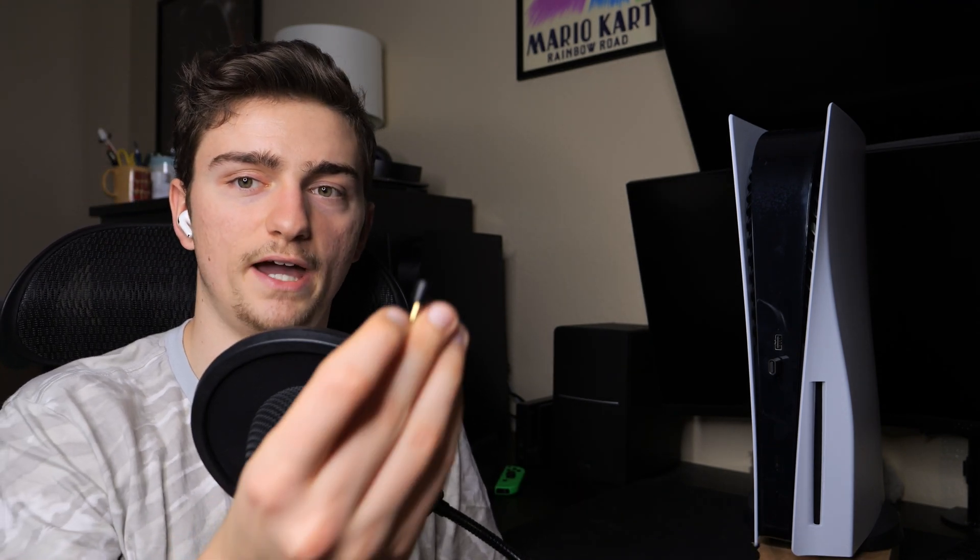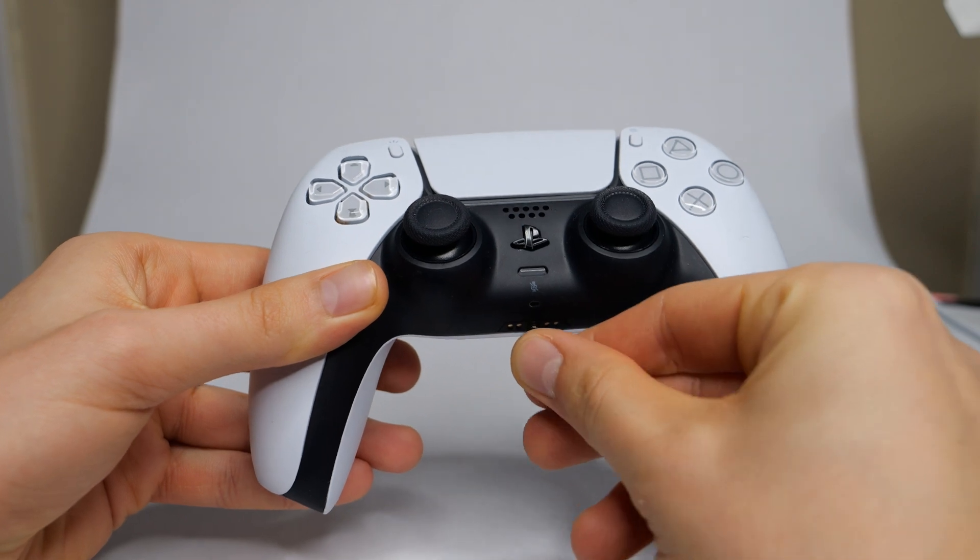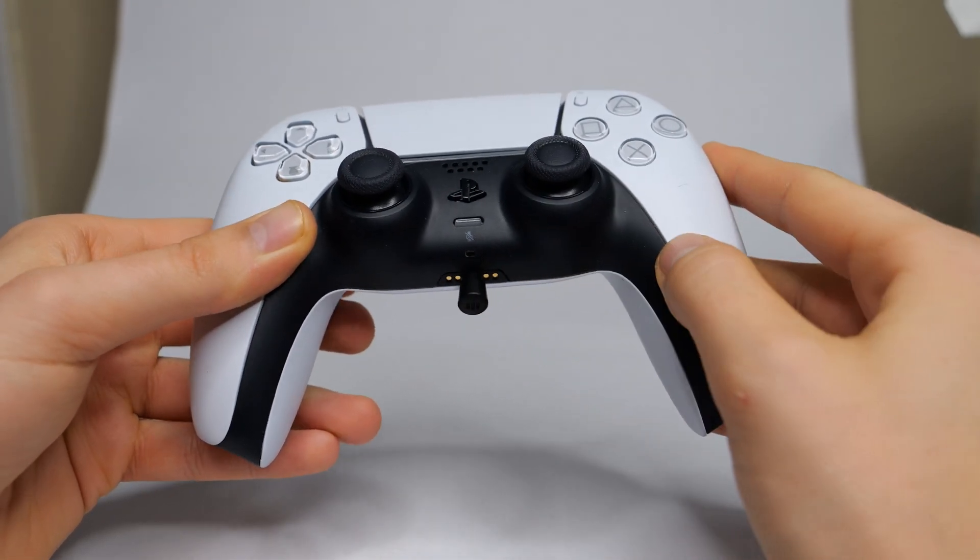What if you want to use a microphone? Unfortunately, we can't use the AirPods microphone, but luckily a lot of these USB Bluetooth dongles come with a microphone audio jack receiver, like this one right here. We can plug this into our DualSense controller, and this adapter will act as the microphone for our console. If your Bluetooth dongle did not come with one of these receivers, you can still follow the steps on the PS5 to set up the microphone — we'll just be setting up the controller microphone instead.